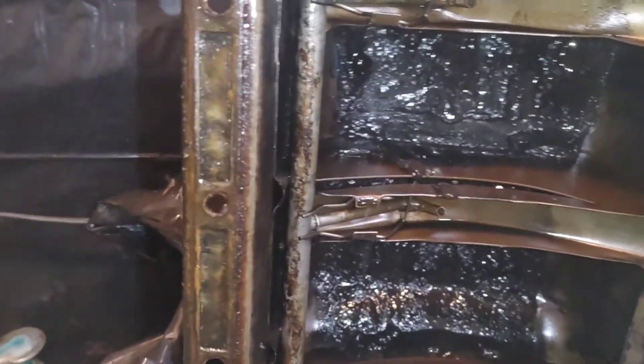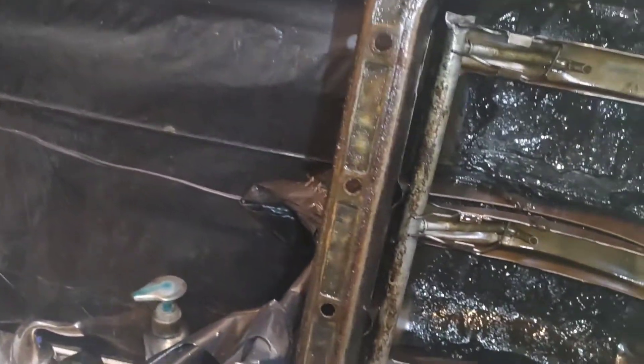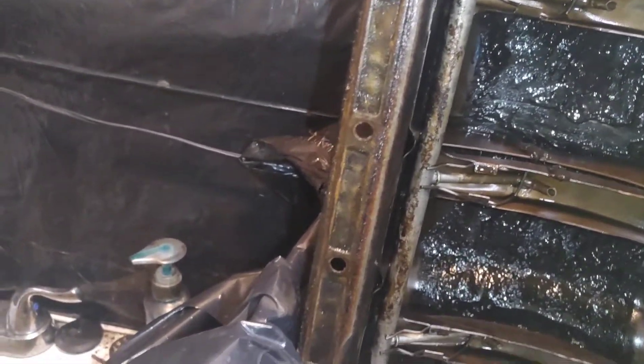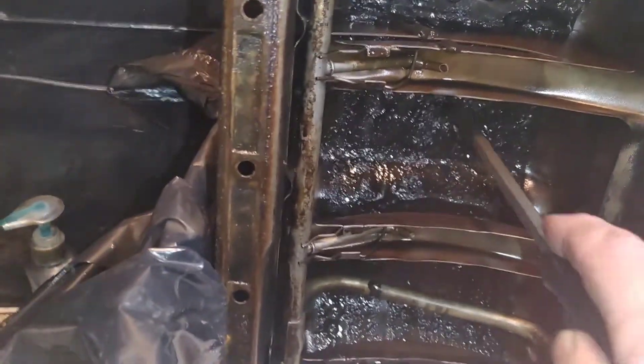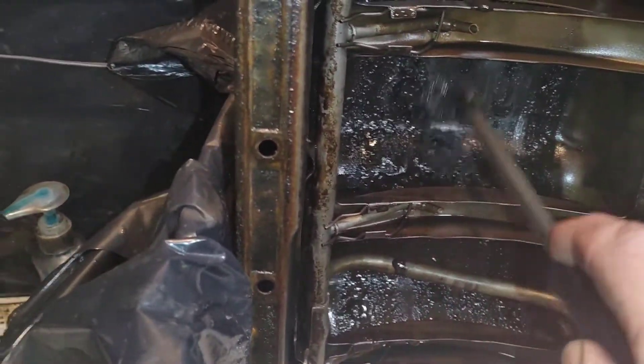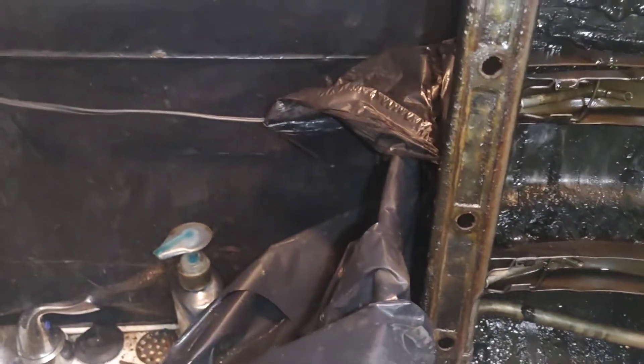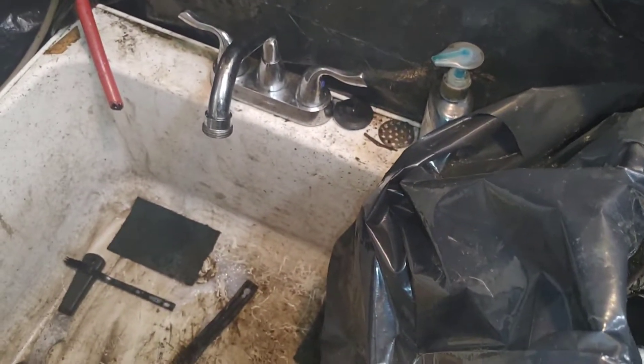The rods are lubricated via these nozzles, and in the trough at low RPM it just picks it up with those little scoops. Without an oil filter, I guess that's what you get, but at least they were smart enough to put the pickup high enough to not pick this crap up. It's in a trash can for obvious reasons with all the rags I've been using.